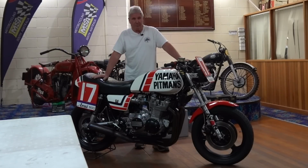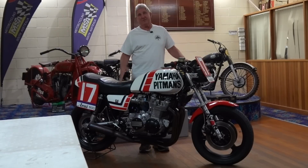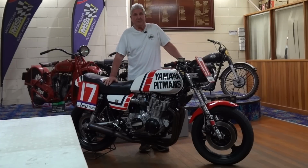The motor seemed good, but because it's 1100, it's got plenty of fin area. If you're out to 1300, it'd probably be a bit of a worry. But we only ever race it as an 1100, so cooling was not too bad. Once it was running, I mean, it gets hot quick because it's high compression, but once it's running, it's good.